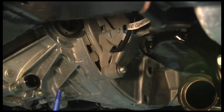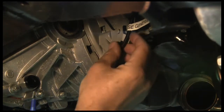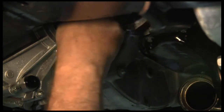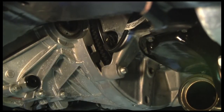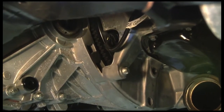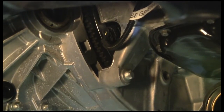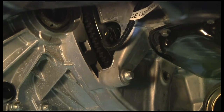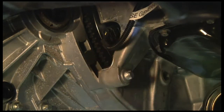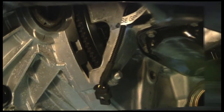What we've located here now is the pulse generator, and this is actually measuring off the revolutions of the crankshaft. Let me go ahead and take the cover off so you can see it. Our hope is that this is going to give us the signal for our tachometer, or that's where the signal for the tachometer is actually coming from, and we'll figure out how to work that in with our electric motor. We've got the cover off, we've got our wire labeled, and we're just going to go ahead and unplug the pulse generator lead and move on.